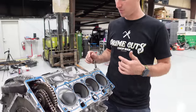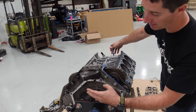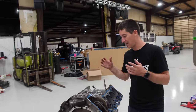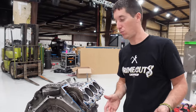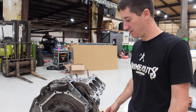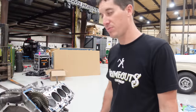The next order of business is pulling the pulleys off the front, and then we need to rig this thing, get it back up in the air and pull the timing cover off the back. If you didn't know, all the timing is in the back — the chains are right here. All the timing is behind the cover where the flywheel sits. On a lot of engines you see all the timing up front; not so here. The serpentine belt's up front, which is normal, but all the timing is at the back of the engine, making it basically impossible to work on without a full engine pull. So we're going to keep taking it down — I think first we'll flip it over and pull the pan off.